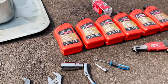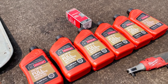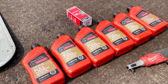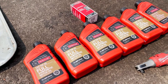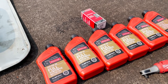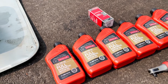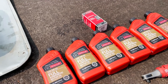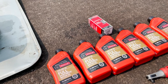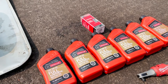You'll need six quarts of 5W-30 weight synthetic oil. I always go with Motorcraft. Technically Ford's spec allows a synthetic blend, but with a twin turbo high-performance engine like this I'd go with full synthetic. If you ever have a warranty issue and you produce receipts for the Motorcraft product, you won't get any trouble from the Ford dealer.